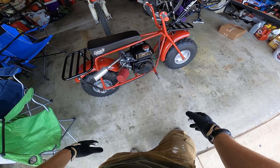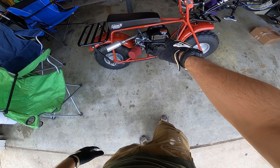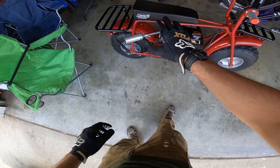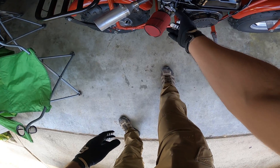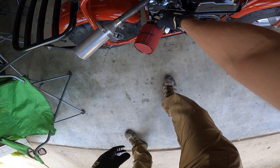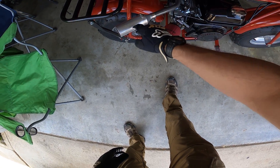Mods wise, a little extensive mods here. We've obviously got ProTaper grips and Honda donuts. I did modify the governor — look out for a cell phone clip at the end of this video for that. We also have a stage one power kit from gopowersports.com that comes with the intake, the nylon cover, the adapter to the carburetor with a little top plate, and a .38 larger main jet.